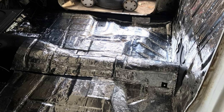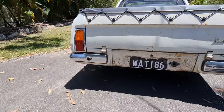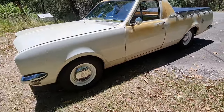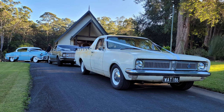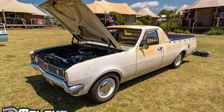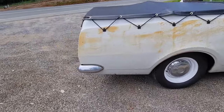The exterior has surface rust on the original white paint — she's definitely a survivor. There's no major rust in the actual body itself. The front guards have a little bit of rust but I left it because it all adds to the sleeper look. Every six months I've applied Penetrol to the paint to preserve the surface rust. The ute has a new tonneau cover made at the same time as the interior re-trim, the original Belmont badges, and some RACV badges to suit the sleeper look. One big change since the first video — a lot of viewers commented that a sleeper's not a sleeper unless it has stock wheels, so it now has HQ steelies with the rear centres moved to suit the shortened 9-inch diff. These wheels really do look great on the ute.